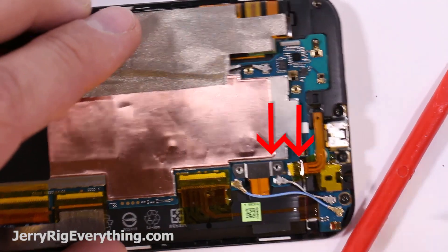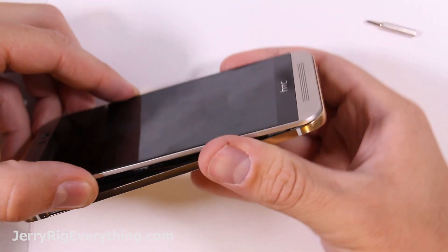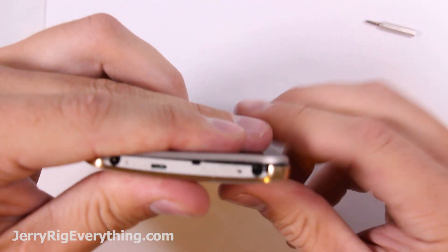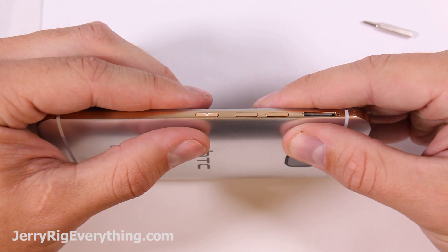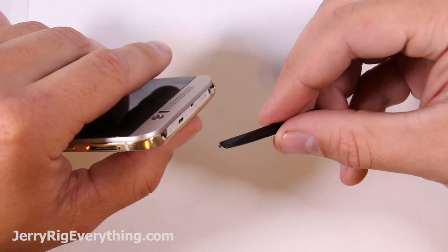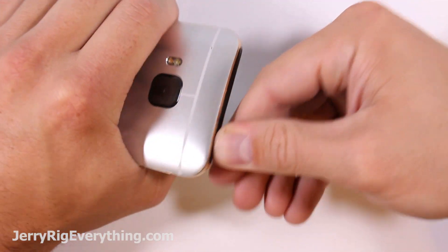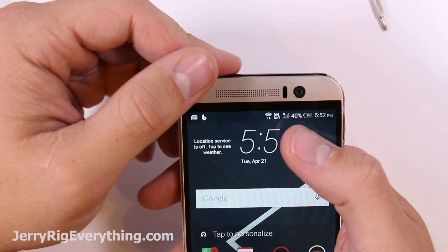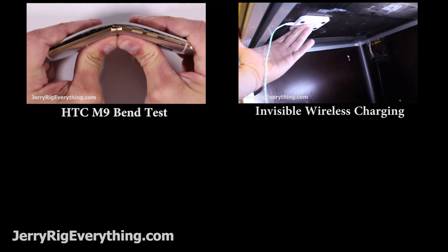Now that everything's taped down and connected, I'm going to go ahead and put the battery in and then get those last two silver screws screwed into the battery connector. You can test the phone while the back is still off — just make sure not to touch any of the circuit boards inside. Then you just clasp the front of the phone back into the back of the phone — it's kind of like a little clamshell. Just snap it back into place; it does require a bit of force, but as long as your ribbon cable connectors are lined up where they should be, you should be alright. Get those top two screws back into place and then press the little plastic bit back down, one corner first. The phone went back together pretty smoothly. Make sure you avoid the edges of the SIM card slots because that's pretty fragile. Plug it back in — the charging port works fine. If you have any questions, leave them in the comments below. Don't forget to like if this video helped you, and don't forget to subscribe. Thanks a ton for watching!